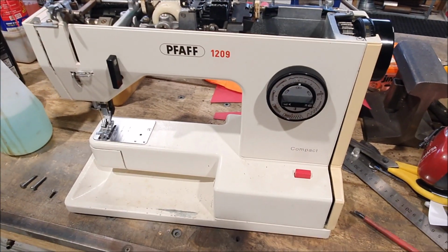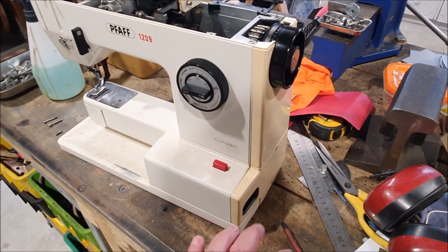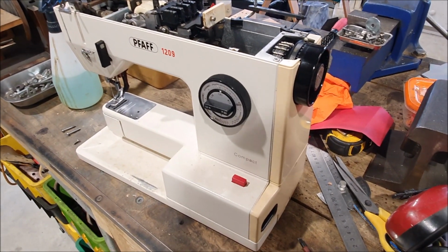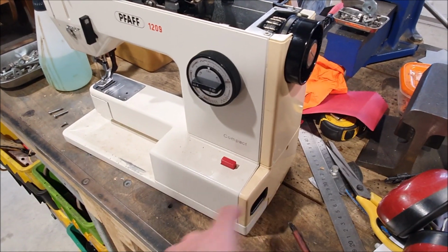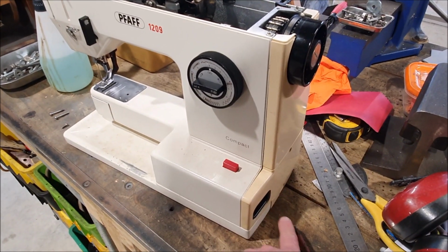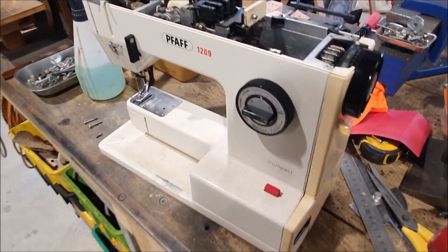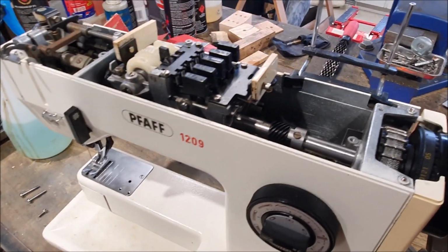Yeah, I'll have to look it up and have a play with it and see if I can actually make it work. I have got my other sewing machine as a Singer. The motors in these machines, especially these older ones, are all pretty similar. They work in the same sort of way. I think it's just a Triac based speed controller. So I'm pretty sure a universal controller and the right cable to plug into this will work. Like I say, for $15 it was worth a try. It cost the same in postage, so it was $30, I guess, if you count the shipping.